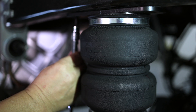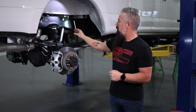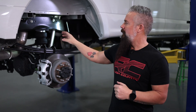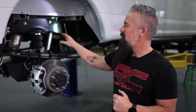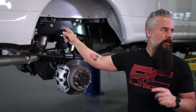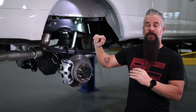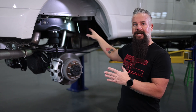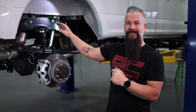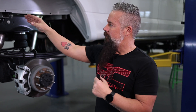We've got our air spring, all the bracketry, and the cradle installed. We're going to go ahead and plumb the system. I'm going to show you how it's plumbed as a standalone — we'll be running lines from each individual air spring to the back where we will replace the bolts that hold the license plate in with our Schrader valves. If that's the system you're going with without a compressor, you'd be done by then. But we're going to keep going and add the onboard compressor, tying into those lines. First, let's show you the easy route and plumb to the back so you can air it up like you do a tire on the truck.